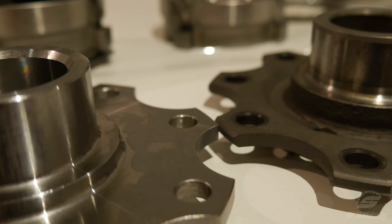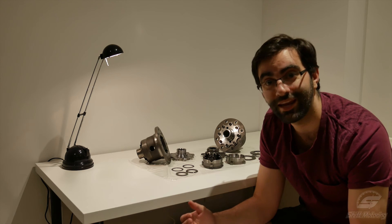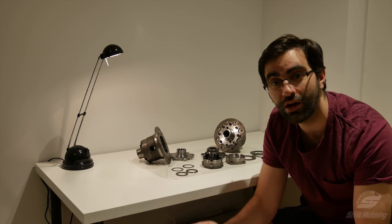In fact, these get so hot that when I pulled the driveshafts out of this unit, where the ends of them sit inside the centre of the diff, they'd actually been heat blued, which means that inside the diff it was as much as 300 degrees Celsius.